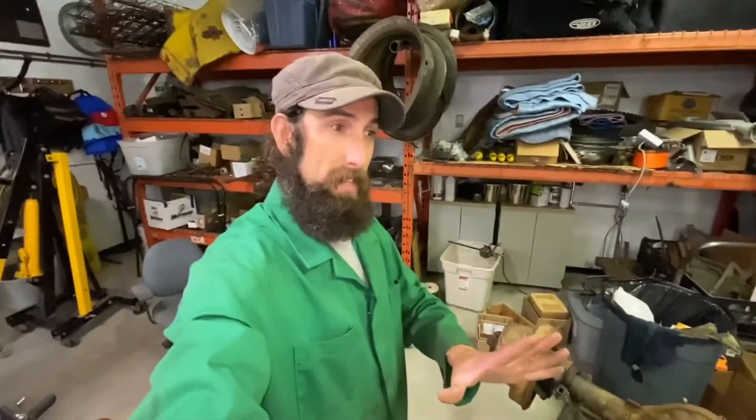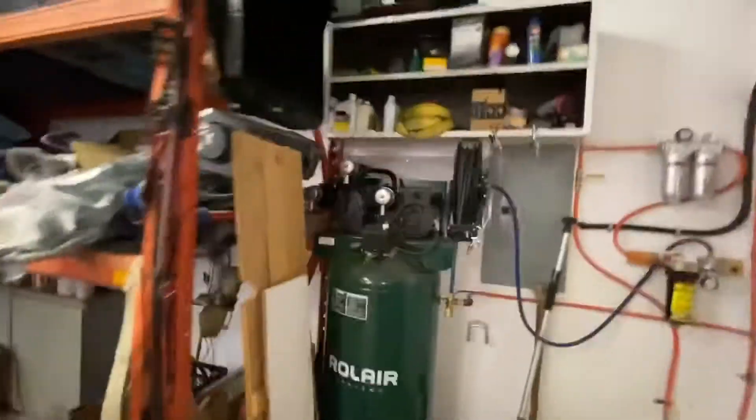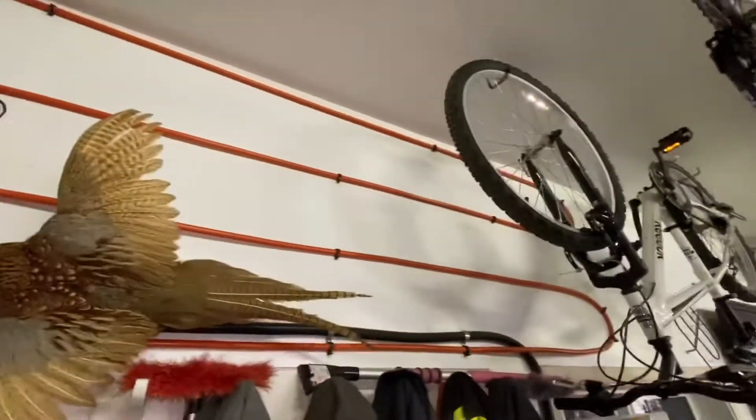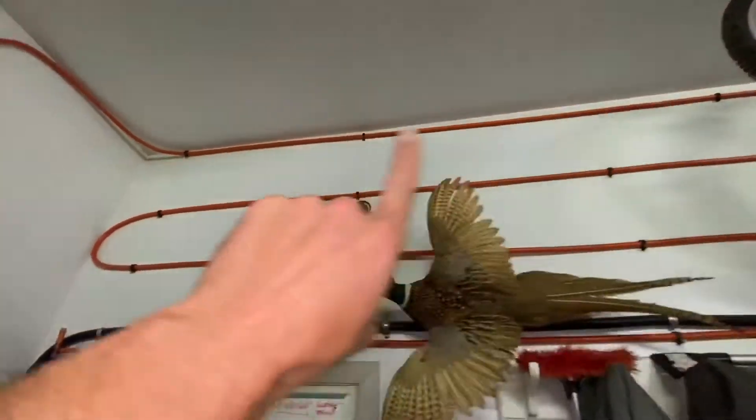It's going to make it much more enjoyable to drive while still remaining a purist to it because it was an option. With the new tires and things I'm putting on, I wanted to get some more efficient steering. Over here I've got my compressor station with lines acting as an air dryer to cool the air, then coming through a first stage filter, a second stage, and a final stage for when I'm painting or sandblasting.